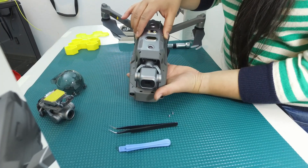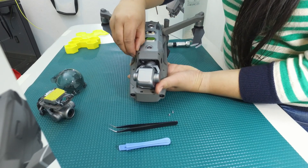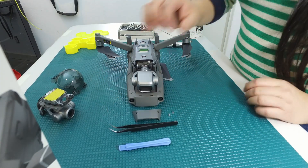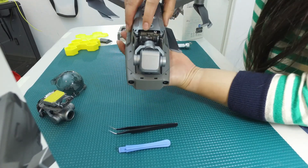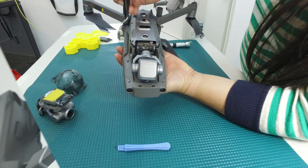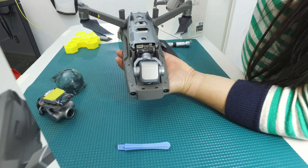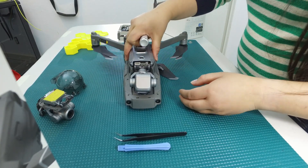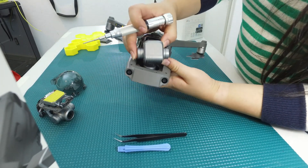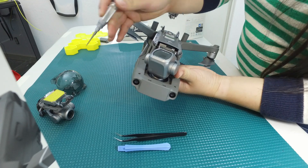Take the drone like this and this piece here is going to go this direction, so you're going to push here and that's going to come out just a little bit, and then you're going to pull on the sides and this piece should come right out like that. Now you're going to see there are two connectors and you're going to take off the one on this side. You can use either the pry tool or the precision tweezers — pretty much get under that connector and unplug it and make sure it's free. Then we're going to move on to four screws again with the hex 1.5 driver. There's also two screws, one in this corner and one in that corner, and we're going to remove those four screws.